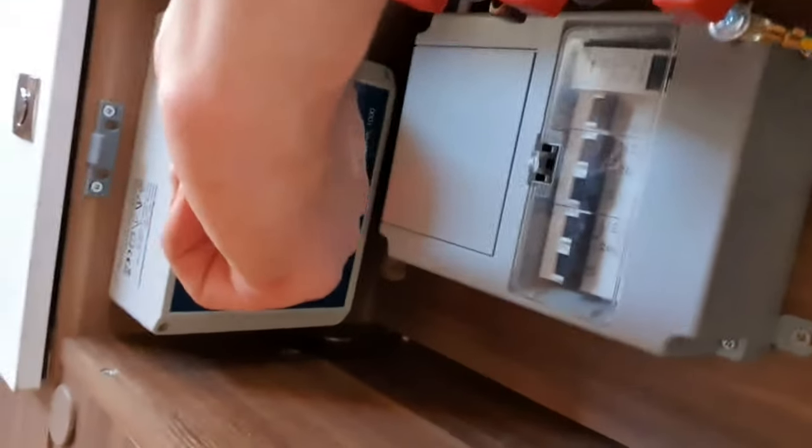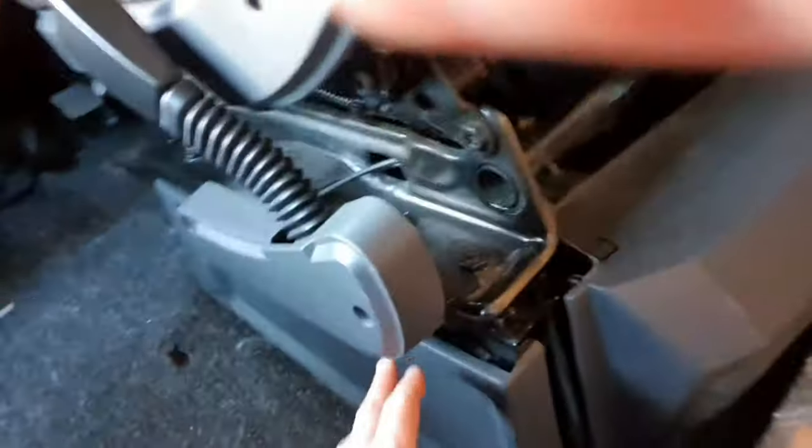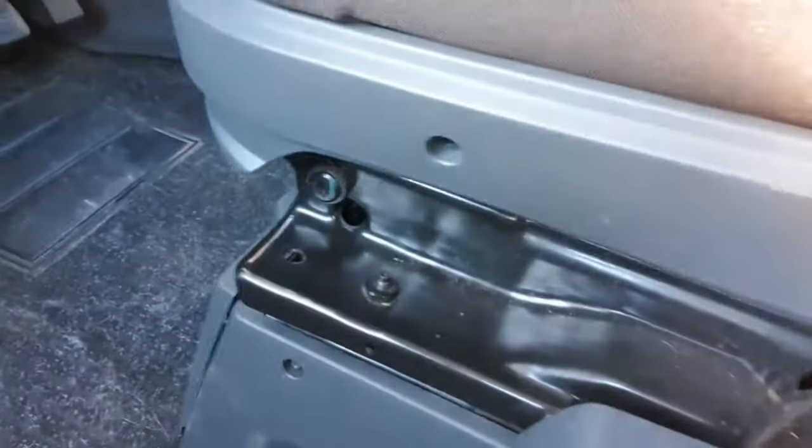Hi, it's John. Today I've been setting up the motorhome so the inverter can power the motorhome electrics when we're off grid. I've connected up this little auto-switchover box — at the moment the inverter is turned on and it's saying the slave is active and giving power to load, which is the main circuit. I put that in and ran a cable from there all the way through the backs of these cupboards, up to the back inside this cupboard, all the way down through here, under here, and into the inverter. If I turn this off you hear a couple of clicks — one is the relay and one is the auto-switcher. The relay I added is just underneath here — it's quite a high-powered one so it makes a buzzing noise.